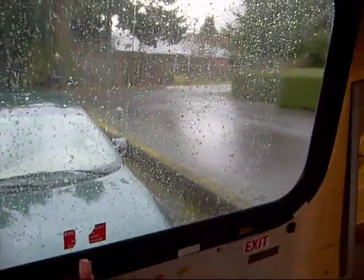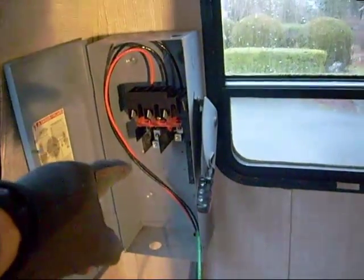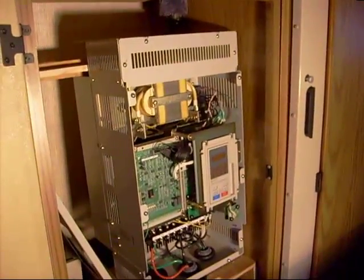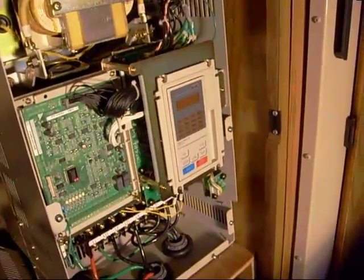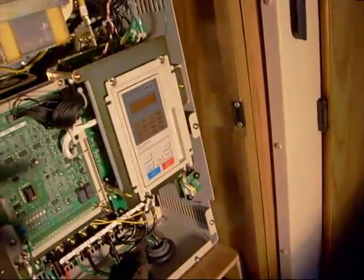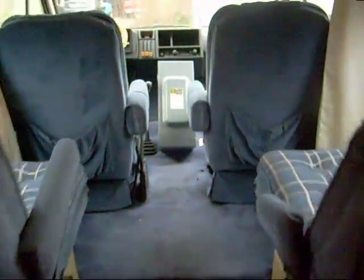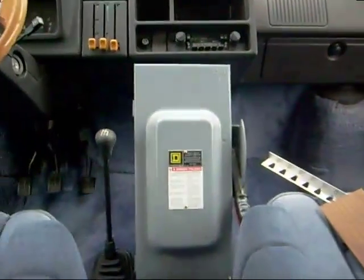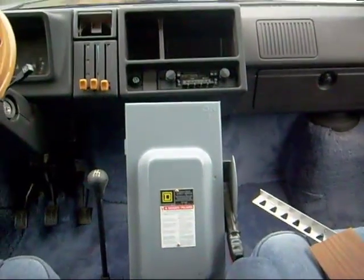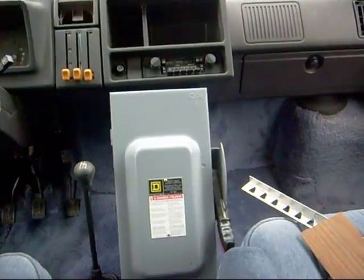This is the back of the motorhome. The sequence of events will be: outside the motorhome will be a generator; the generator will come through and attach to the disconnect here; from that disconnect we'll go to the variable frequency drive in the cupboard, where the wires connect to L1, L2, L3. Then from terminals T1, T2, T3 there will be a conduit going to the front of the motorhome to a disconnect, and from that disconnect it goes outside to the electric motor — that is where it all happens.